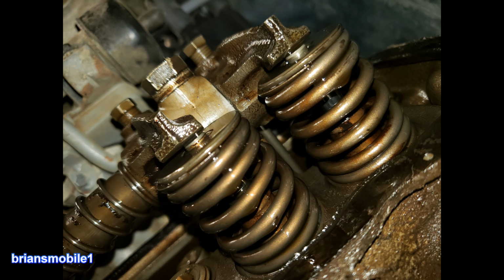solved. So to get this out, obviously you pull the hose off here, and then there's an 8mm bolt here and here, and then when you go to pull it, you gotta pull it straight back. I rock it like this, do some spray silicone in there, and then pull it up. And you see that the fuel goes through the line down into here. Either it'll come out of the O-ring or the O-ring will come out. Either way, just make sure that all of it is intact and comes out. This was stuck in there, so I had to fish it up and out.